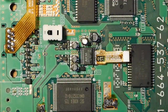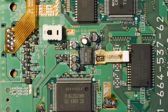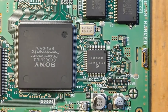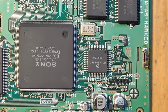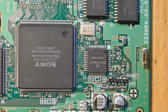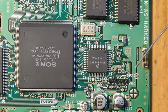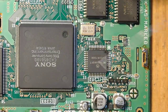The audio flex cable is now installed. I'll go over it with the microscope to make sure it's good, then we move on to the toughest part of this modification: the GPU flex. You technically can do it without magnification, but I definitely do not recommend it. The points are very small and you really need to be looking in there to be sure nothing is bridged or poorly connected.